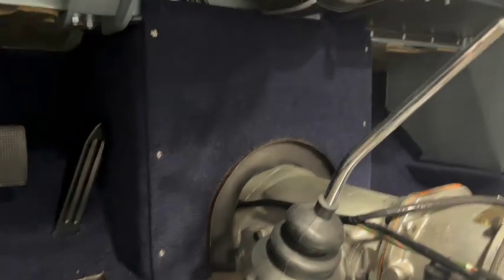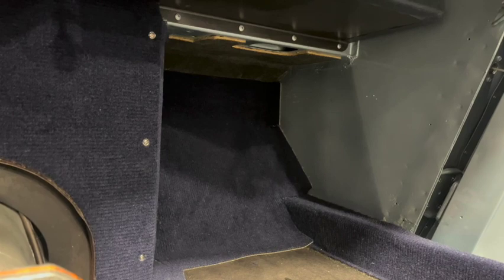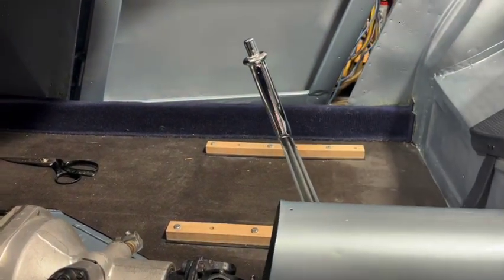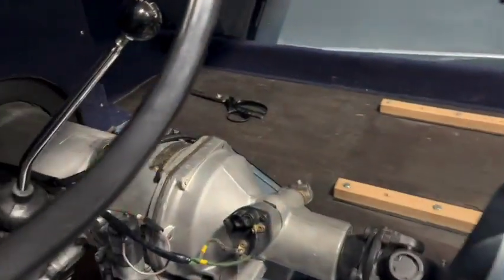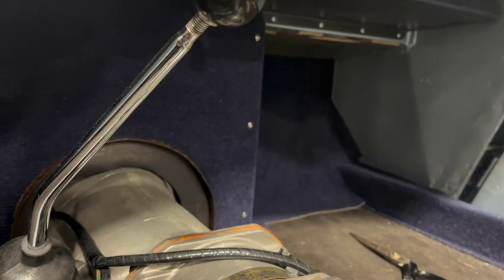The jute under-felt is in the top and this guy just screws in with three-quarter-inch long trim screws and washers — similar to what the panels use but a bit longer; panels are five-eighths and these are three-quarters. That rubber nicely seals around the gearbox. On the passenger side, notice there's overlap down onto the floors and where the kick panel is going to be so there are no gaps — that is intentional. My pieces are all a little bit oversized. Sills on Healey carpets overlapped onto or underneath the next piece to go in, and at the back the armachord comes and neatly cuts around that. Same thing on the floors — the mats overlap that edge — so it's all nice and neat with no gaps.